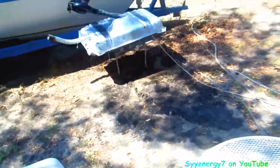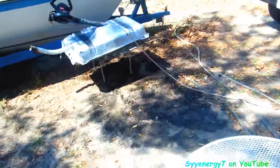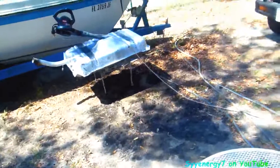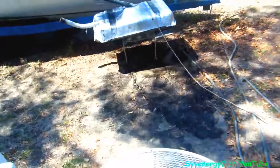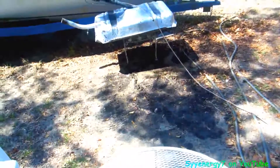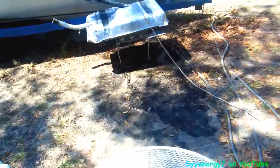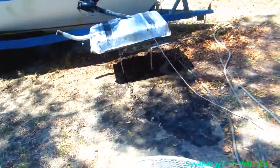Probably the best thing would have been to put like 5 gallons of vinegar with 5 gallons of water and really let it swish around. I didn't notice any rust until I was swishing it around every day a little bit, but there was rust up on the side — I didn't notice that, it was apparent later on. But it'll be much, much better than what it was, and the red coat might cover the whole tank with what I've got left, so good enough.